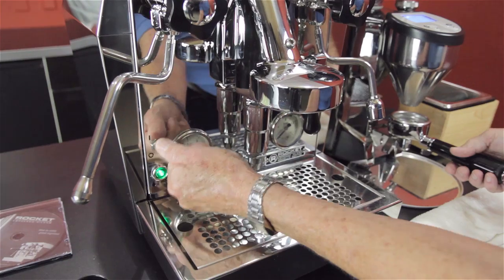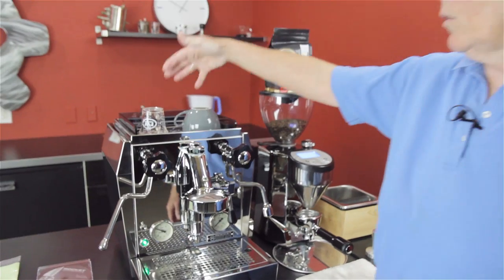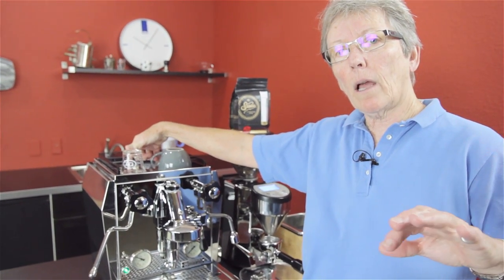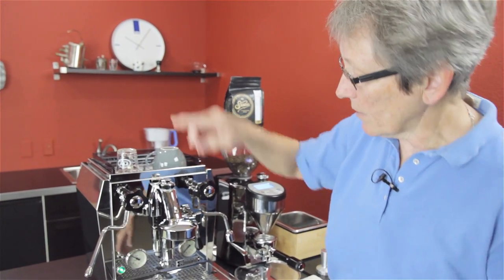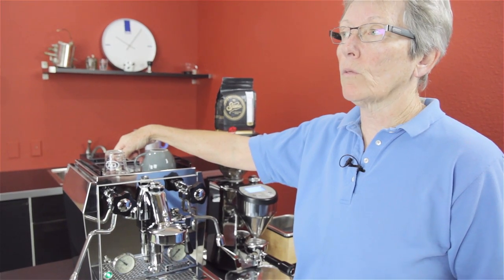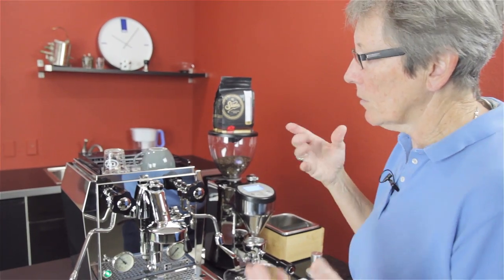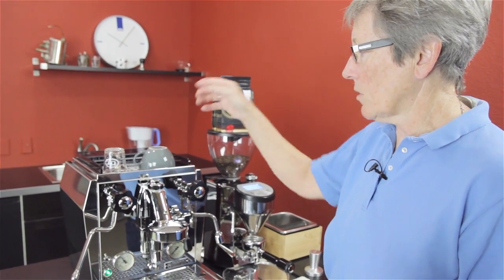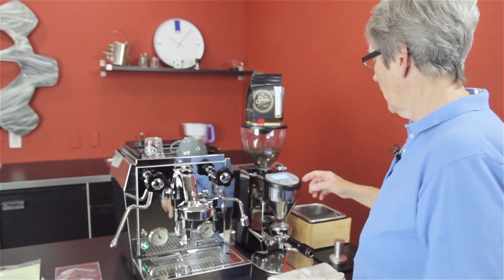This slide over here indicates that the machine is on or off. You want to use water that has a little bit of minerals in it — not a lot, a little bit. Filtered, but not distilled or reverse osmosis. If this light is blinking, that's an indication that the water tank has either run out of water or you've used water that is filtered way too much. Make sure your water has just a little bit of minerals in it. There's a sensor down in the bottom there that senses the minerals in the water as it's passing by — if there's no minerals, it thinks it doesn't have any water, even though your tank is full.